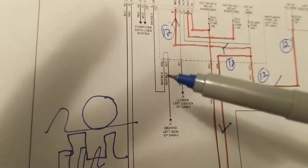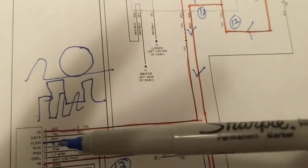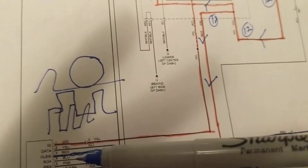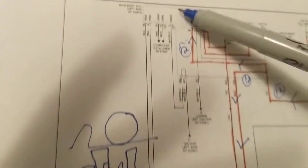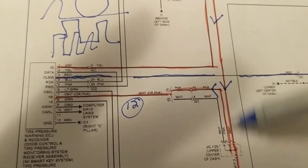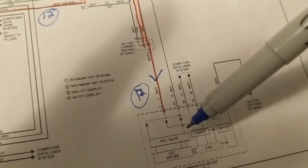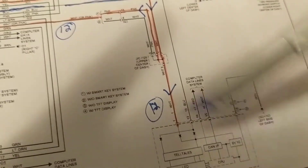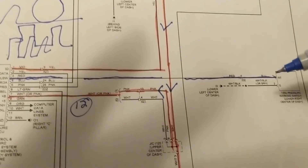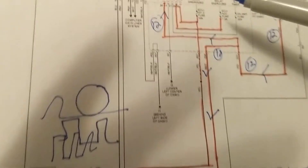If you put on a new tire and the receiver says it doesn't detect anything — no ID number, an unknown tire — it signals to activate the tire pressure warning indicator for the driver. The warning light is the result of all these modules communicating. The display itself is usually not the problem; the problem is most often the receiver module or the transmitter valve.